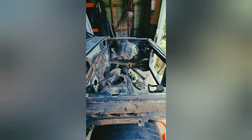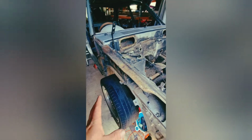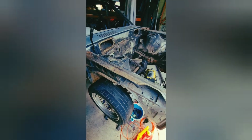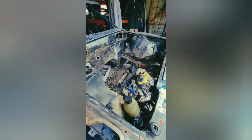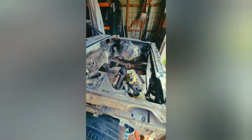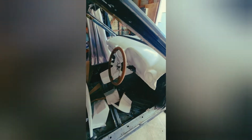But yeah, quick rundown. We're going full Nissan front suspension, get a bit of steering lock happening for drifting. I've got a 4G63 T motor out of a VR4, so a 6-bolt. Probably run a Sigma or L200 gearbox for now because they're cheap and bolt directly up to it, but it won't last. And in the rear we're doing the full Nissan diff and suspension and subframe as well, so there's a fair bit going on, but we'll go more into depth in a second.